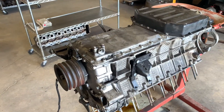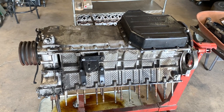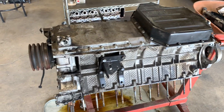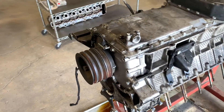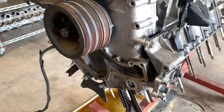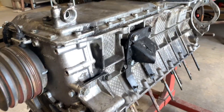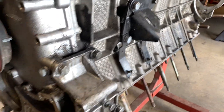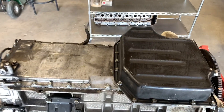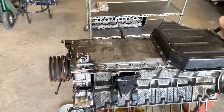As we begin to take the bottom end apart, I think it's important to accentuate how important it is to keep everything organized so that you don't spend half your time trying to locate fasteners and small pieces as you put this thing back together. What I do is I break things down into assemblies. The first thing I do here is knock off the harmonic dampener up front, and all the bolts on the front cover, including the water pump bolts, all go in one bin. Brackets that get bolted to the block — like the mounts on both sides and the alternator brackets — all those fasteners get put in a bin. And the oil pan stuff, even the internal ones — you've got these that go around the perimeter but also on the inside you've got the windage tray — keep all those in the same bin. It just makes things a whole lot simpler.